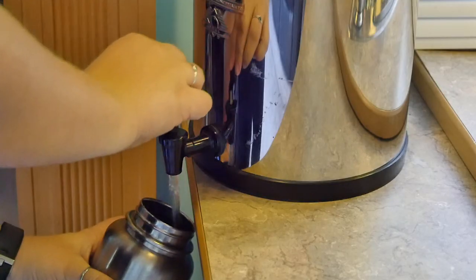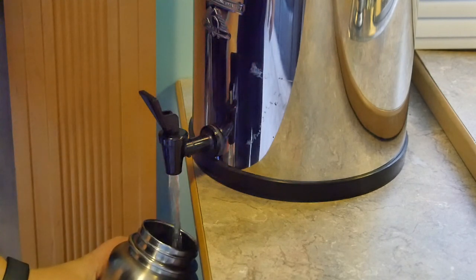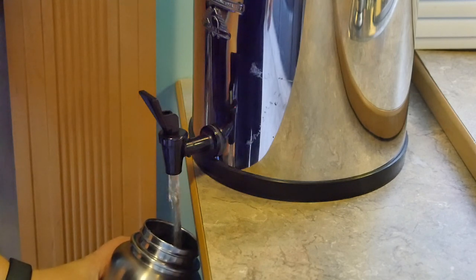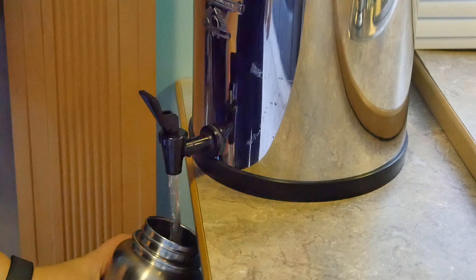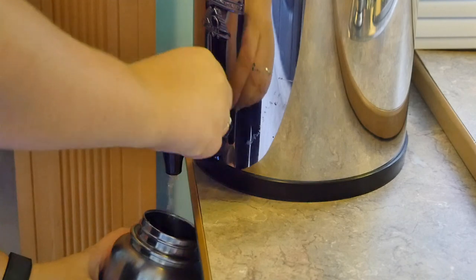The Berkey is super easy to assemble. When you first receive it, it comes in a very compact package — I was very impressed. I thought it would be about the size of what it looks like assembled, but they put it all together in a way that makes it a lot smaller. One of the main things you must do when you first get your Berkey is to prime your filters. I'm going to have a link to the official video on how to do that, but you want to make sure that water is going through and saturating the entire filter. Follow their instructions to a tee — that is going to make for the best filtering water. If you do not prime it, you are not getting the water that the Berkey is intended to provide you.